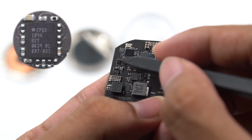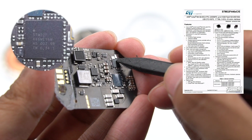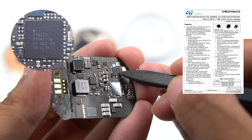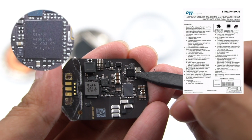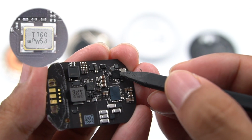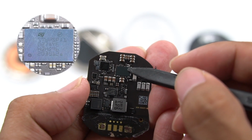Type-C port controller comes from Cypress CYPD2104. The master control chip for wireless charging adopts ST Microelectronics STM32F446MEY6. This is an MCU with DSP and FPU, and it has 512 KB flash, 180 MHz CPU, ART accelerator, and dual SPI. A crystal oscillator is next to it and provides the clock for the master control chip, used for identification and authentication.